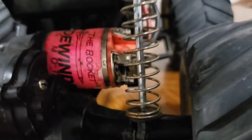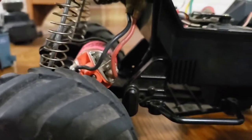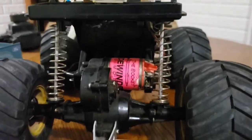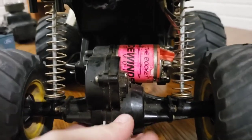Just a quick picture — there we go. It's not pretty, but I just had spare parts. It's a third link that centers the axle for the rear in the middle of the travel. That way it can still flex up — it can flex like this or this — without actually having any issue with the axle doing any weird rotations.